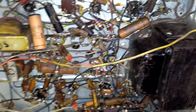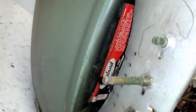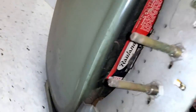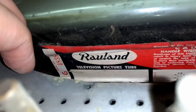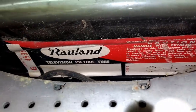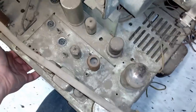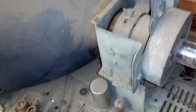Big old power transformer down here — these are pretty reliable, well-made sets, as are most Admirals. There's that control with the shorter replacement shaft. And there's a replacement picture tube — looks like a relatively new label on it. I don't have a CRT tester with me but this could be a pretty strong picture tube. Looking at the top side — very minimal corrosion, some of it is copper-plated. Not bad for free; I'm not going to complain.